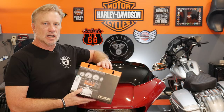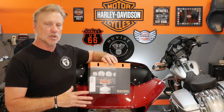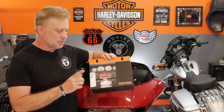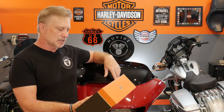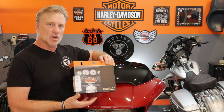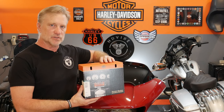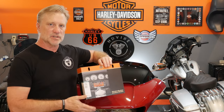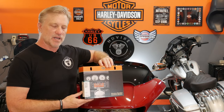In order to connect your wireless headsets to the infotainment systems on your 2014 and newer touring bikes that have the infotainment system, you need this part here, which is the Wireless Headset Interface Module from Harley-Davidson. I'll put the part number and a link to it on the Harley-Davidson website, but it's part number 76000768. If you have a 2018 and newer Street Glide, Road Glide, or Ultra Limited, you just need this. If you have a 2017 and older — essentially 2014 to 2017 — there is one additional harness that you need to get, and I'll put that in the description as well.